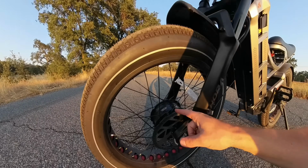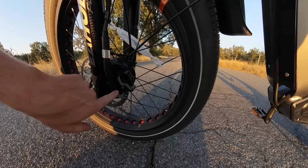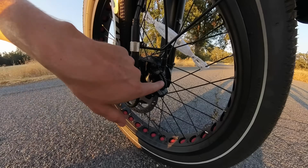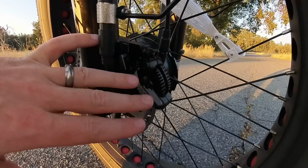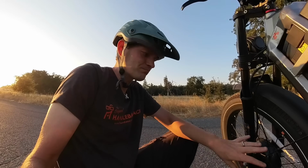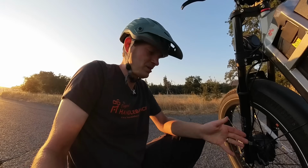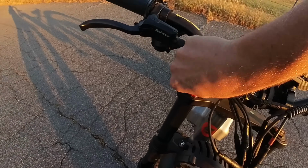It actually has some really thick disc brakes. It's actually kind of cool. These are 4-piston hydraulic brakes, and then the pads have these heat sinks on them to keep them cool, both front and rear. That might seem like a gimmicky thing, but heat sinks on pads is a real thing. Those probably actually do help. It does have, though, I gotta add, a compression adjustment.